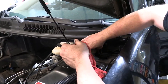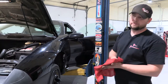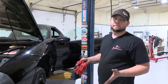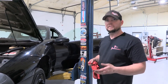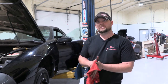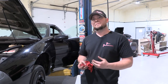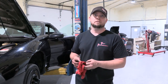As far as the master cylinder is concerned, our install is done. If you plugged it up to your slave cylinder and your slave cylinder was the same one you've been running, it would already have fluid in it, so you would technically be finished — unless you wanted to flush the fluid in that slave out, in which case you could continue the bleeding process through the bleeder of the slave cylinder itself. We've finished the install of the master today. The car obviously doesn't have the transmission, slave, engine, and other parts needed to finish the bleeding and install process, so we'll follow up this video with another video in the coming weeks that will showcase bleeding through the slave, the proper way to adjust with the engine running, rev testing, and other things.